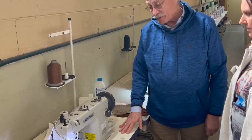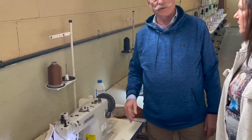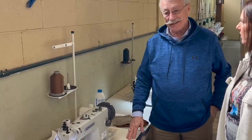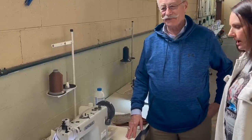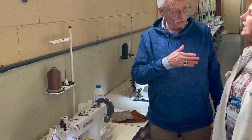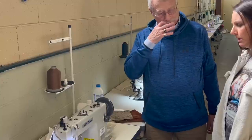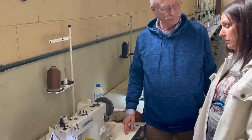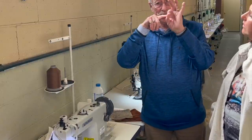It takes a standard industrial sewing machine needle for a walking foot, which is the 135x17, giving you the ability to use anywhere from about a size 9 all the way up to about a size 26. I like to sell with an 18. My suggestion: if you're going to do leather and you're using thread 69, go up to a 20 or 21. The 18 was working for me, but maybe I'll try the 20.